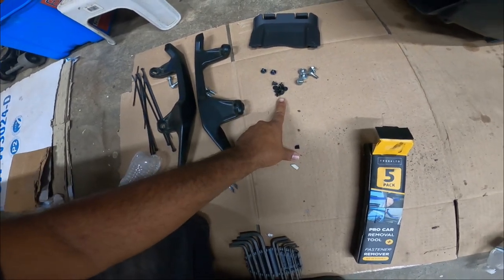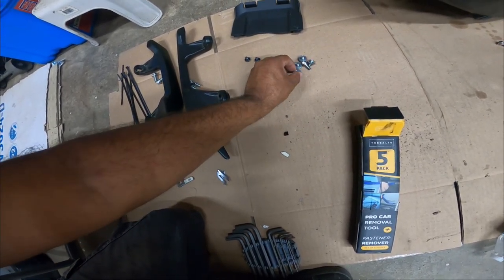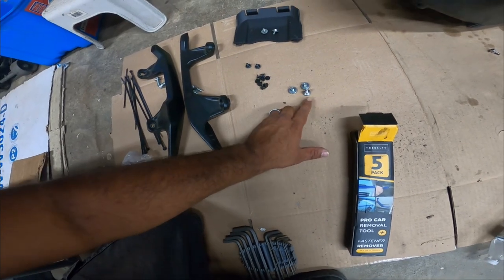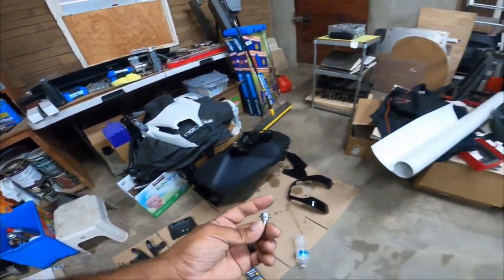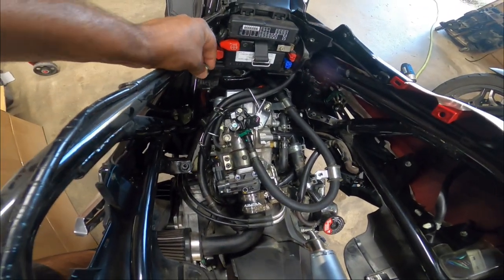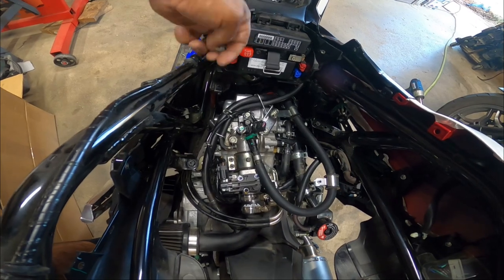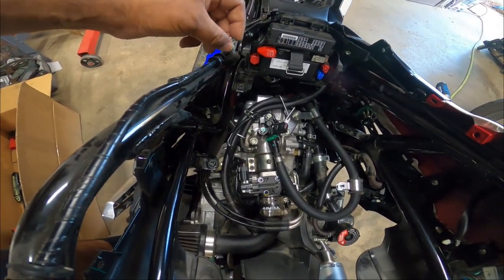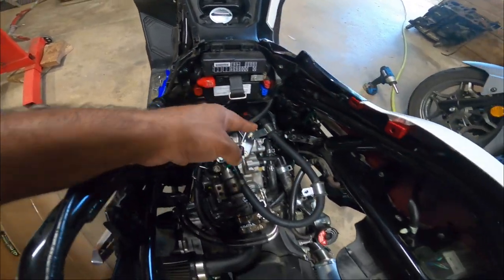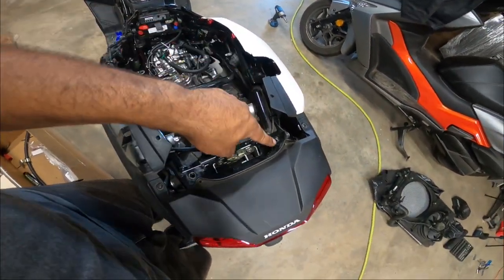You have these for the inner liner of the tub on the sides, and then there are five bolts — all with the same 10-millimeter head, but one is different. Two go inside the battery compartment and three go in the tub. The different one is recessed and goes specifically in this corner — the plastic layered here has a recess so it locks everything in place. The other 10-millimeter bolts go here, here, and here, and the 12-millimeter ones go here, here, here, and here.